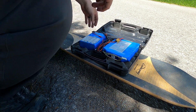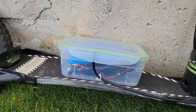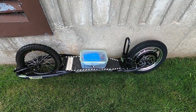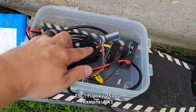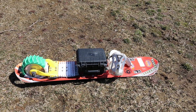I specifically chose this voltage so I can reuse the batteries from my electric skateboard, so that every time I do a new DIY build, I don't have to buy brand new batteries — I can just reuse them across the various projects. To hold the speed controller and the batteries, I bolted a simple plastic container to the deck. It had to be relatively small since I don't have much space on the deck, so everything is pretty constrained in that little container. The ESC itself is a FlipSki 75100 single speed controller, and the remote is a VX1, which means I can control it exactly like an electric skateboard — pretty much a very similar setup to my electric snowboard project.